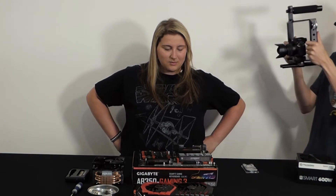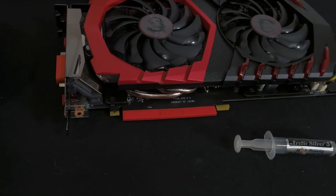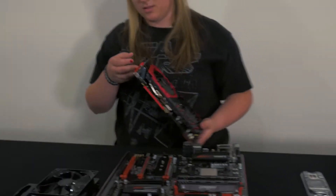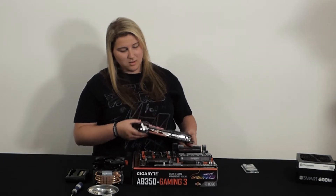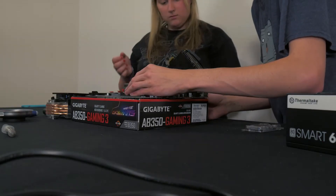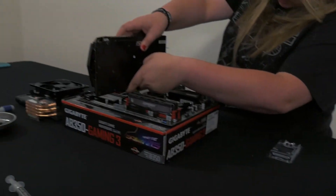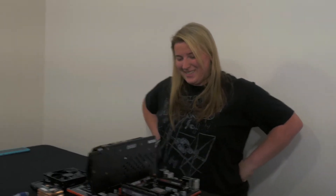The next thing we are going to do is put the graphics card in. So take this graphics card, take all of the little red protectors off, and socket it in this slot right here. Pull that tab back. Now take this graphics card and take off all those little red protectors — even the bottom one. We're going to bring this to the edge because that little lip has to sit over the motherboard. Go ahead and socket that guy in there. Like this? Yep, just like that. That was perfect — until you get a nice, satisfying click. Excellent. You just put a graphics card in. Doing great. You're blazing through this.